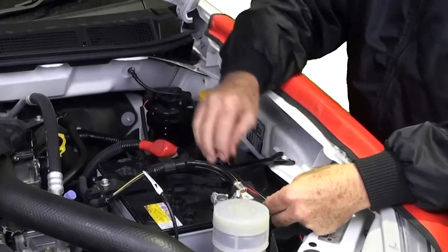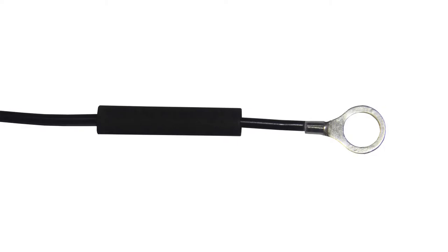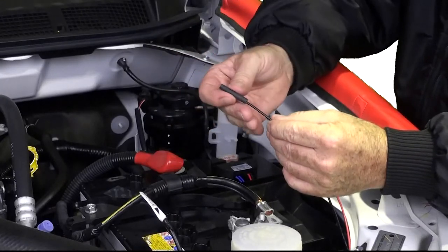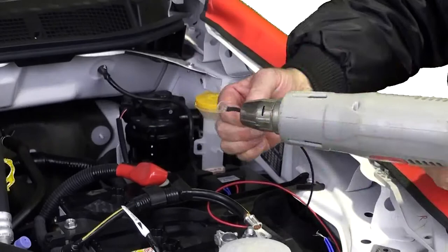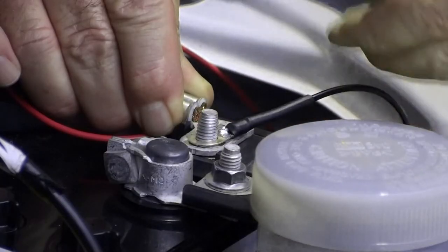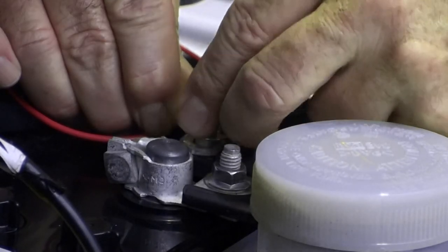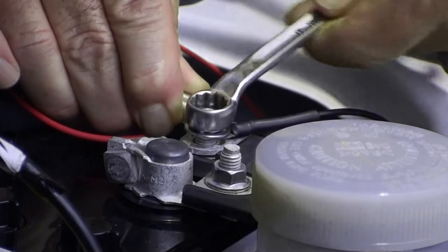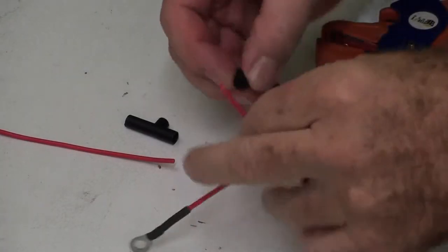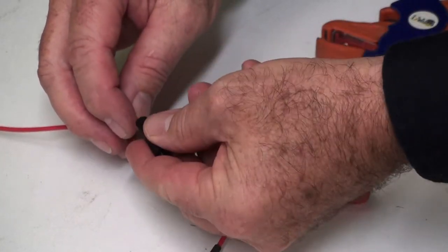Now run the red and black wires permanently to the battery and cut to length. Solder the ring terminal to the negative or black cable, ensuring you install the heat shrink onto the wire before soldering. Heat the heat shrink using a heat gun or similar, then connect the black wire to the negative terminal of the battery. Do not remove existing wires and cables — simply undo the nut while holding all existing wires firmly in place, slip the ring terminal onto the battery bolt and re-tighten the nut. Connect the fuse to the positive red wire using the straight joiner, but do not connect to the battery until the final stage of installation.